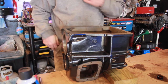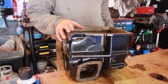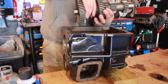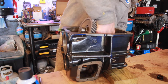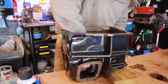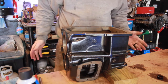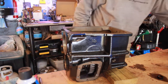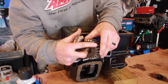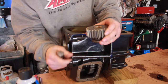Okay, let's get this bad boy back together. First thing I'm going to do is drop the counter shaft in so it can rest on the bottom of the case. Just kind of angle it in there so it rests. Then we're going to put the reverse idler gear back in. Mine's a little chewed up on the front — I said earlier I'm not too worried about it. It's from grinding when you go into reverse, you know.